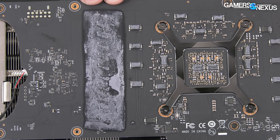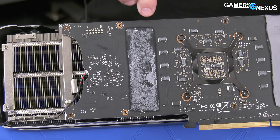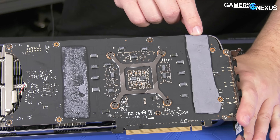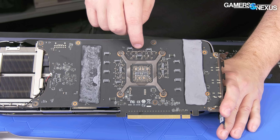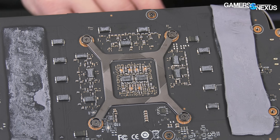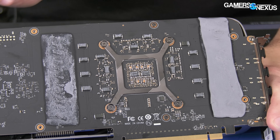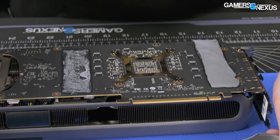They use more of the clay-type thermal pad here and covered basically everything. Looking at the back of the VRM — that's going to be the back of the inductors and the mosfets, which are the ones that matter. Even though it's on the opposite side of the PCB, it can still pull heat through, and that's effective. This is also going to be on the back of the other half of the VRM. These spots here correspond to the back side of where the memory is mounted. Memory is flip-chip BGA, meaning it's close to the PCB surface, so the silicon may actually be closer to this side than the top of the module package.